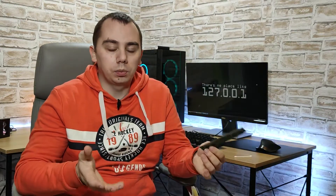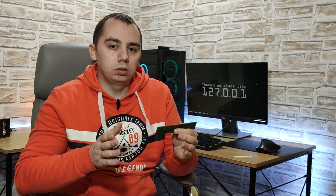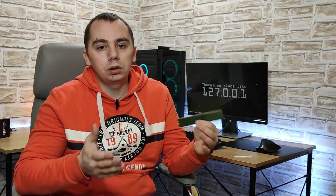Sometimes we even see things like a memory slot on an old motherboard that just refuses RAM. You have a RAM stick that works in the first slot, and the second slot doesn't accept it. Those things can also get dirty, and dust can get inside of them. Usually I try not to meddle with the slots — they have fins inside that are pretty fragile. But you should try, at first, blowing as hard as you can with some compressed air on them. Use a can, not a full air compressor, so you won't damage the fins.